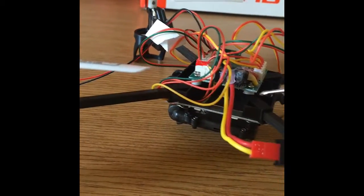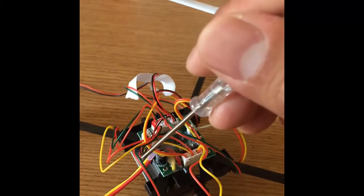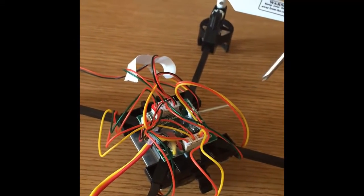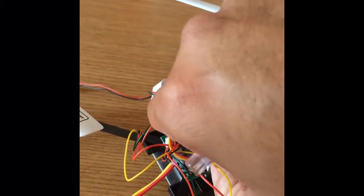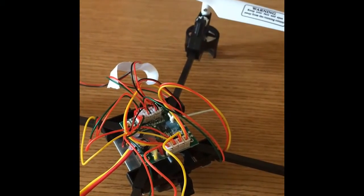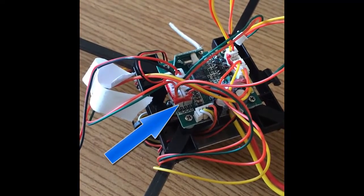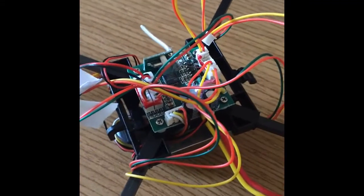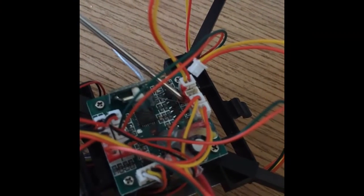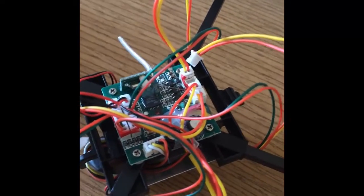In order to take off the arm, there's actually a screw. All you need to do is take off the yellow and orange pair that go to this socket over here, and then take off these guys that go over here. Make sure you remember where they go, because this is the same spot you'll have to reconnect your motor to. There's a little groove in there — just put your nails in there and lift it up. There's actually some red goo on there, and that's making it kind of tough. I cut that red goo to make it easier to take off, because otherwise that red goo holds it in place.